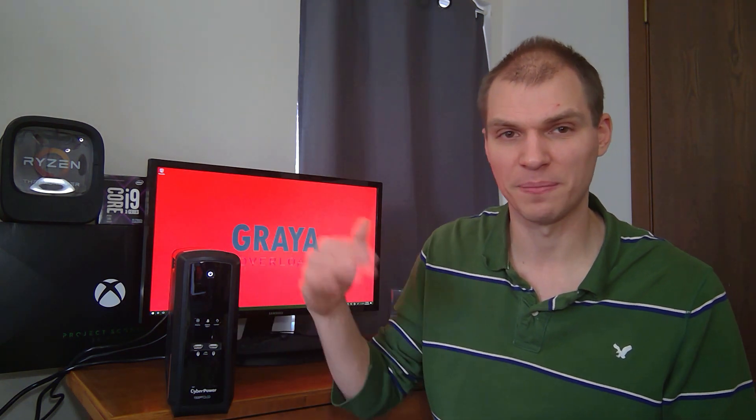This unit also has Green Power UPS, which is CyberPower's patented bypass design. If your power is clean, it allows utility power to pass through the system, skipping a lot of the internal circuitry. This makes it much more efficient, using less energy, producing less noise and heat buildup. So if you have clean power, there's a great benefit to this feature as well.